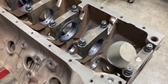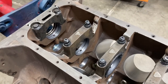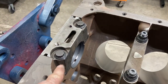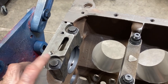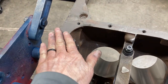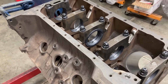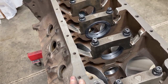Waiting for it to warm up a little outside, I went ahead and checked some main bearing clearances. We have studs on the front four and bolts on the back — we started doing this a long time ago and then ARP started offering kits exactly like this. The reason is the stud sticks up too high at the rear where your oil pan sits. We started putting bolts on the rear cap, and ARP now offers kits that way — everything is under the surface of the pan rail, especially with a gasket on it. We've got our calico-coated Federal Mogul main bearings in there checking clearances; we're going to have to adjust a couple of crank journals with some polish to get them dialed in.